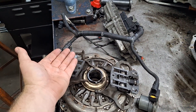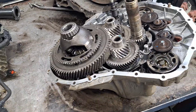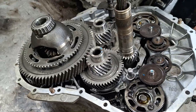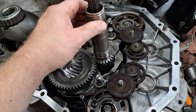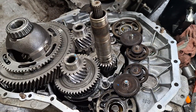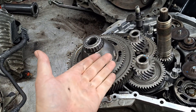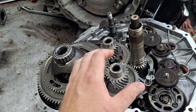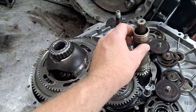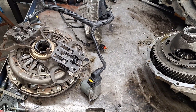There you have it folks — just a quick overview. This transmission is essentially two different three-speed manuals in one case, because each of these shafts can be controlled independently. The transmission can actually have two different gears applied at the same time. For example, if you're driving in first gear, it'll have second gear applied as well, but it won't be engaged until the clutch engages. Each clutch is splined to a different shaft — that's how they get away with that.